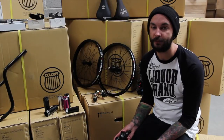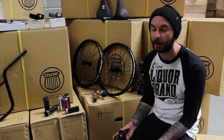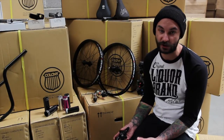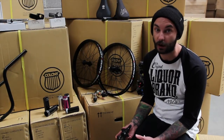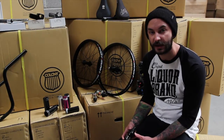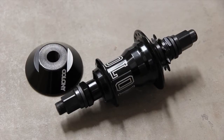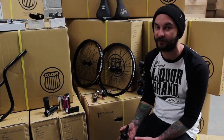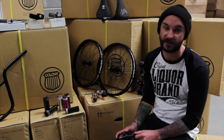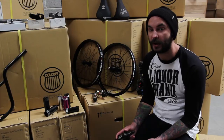To kick things off with Colony, I've chosen probably one of the hottest and most talked-about products at the moment — the free coaster hub. This is Colony's version, using the standard patented KHE internals with three slack adjustments in the Colony shell, which is CNC machined. It has oversized bearings on the drive side and clutch side, standard cones on the non-drive side. It's a little bit smaller and slimmer than some other stuff on the market, and being a free coaster it allows you to disconnect the drivetrain and coast the bike backwards.